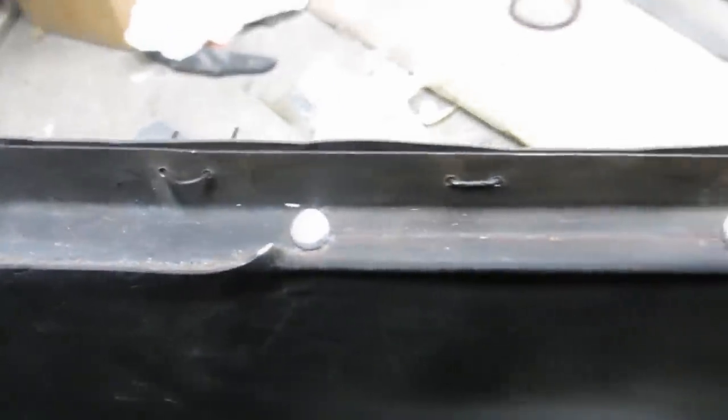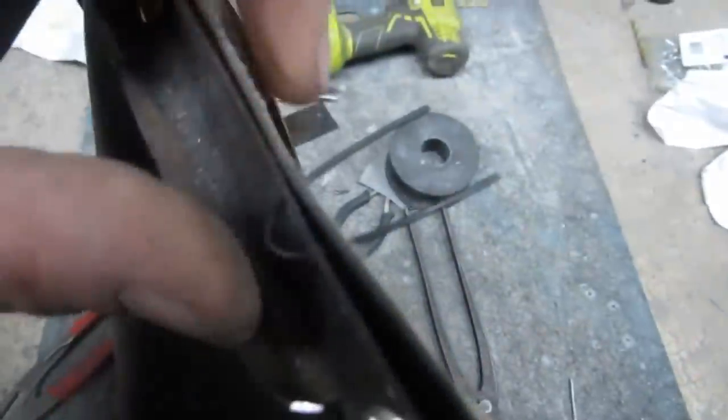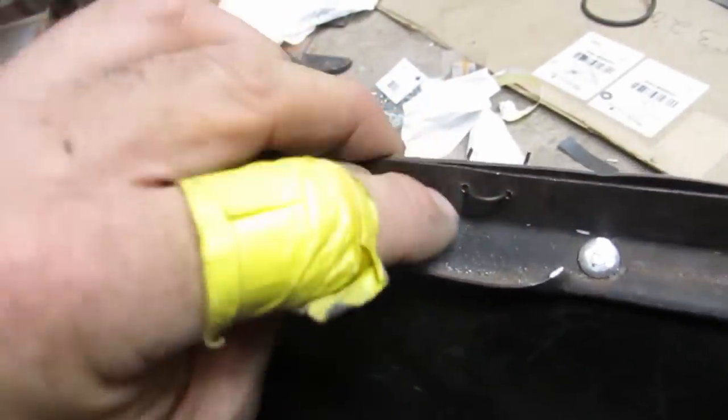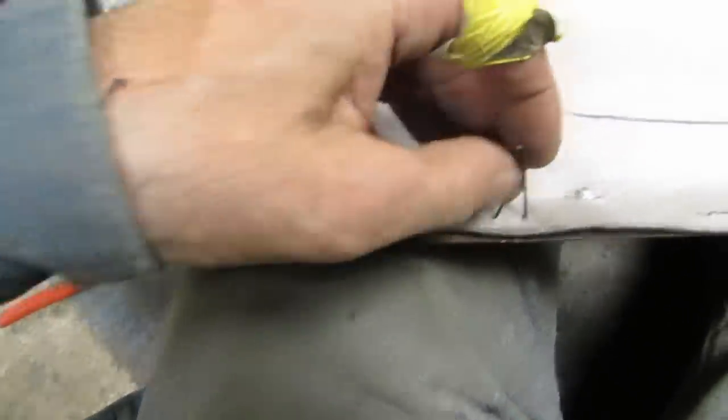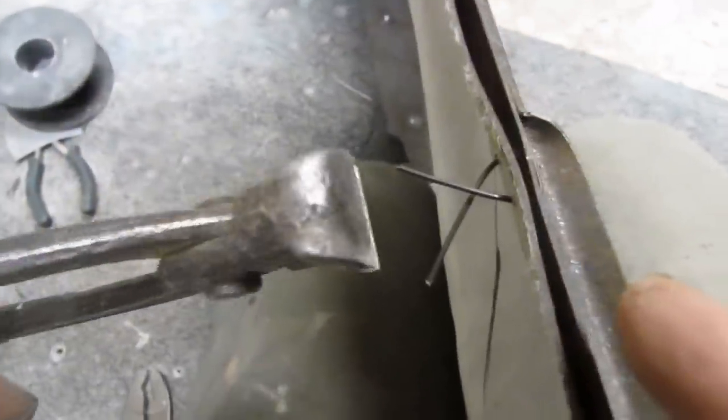All right. We're moving along on the Citroen radiator shroud tent thing, and originally it was riveted and stapled, so I'm trying to recreate that. A handy trick for making these staples: first run the smallest drill bit you can through the holes to clean them up and punch through the vinyl. And then take a pair of pliers and just give it a little of this, and bend them over each other. Don't matter really if it's tight at this point. Then take your farrier's snips here.